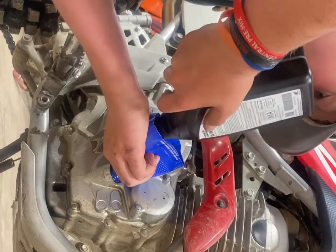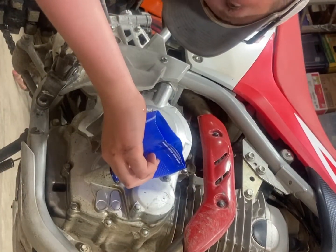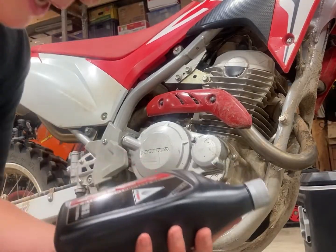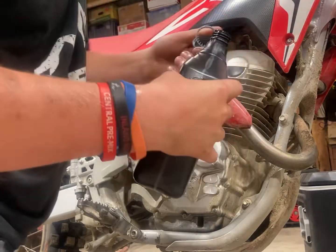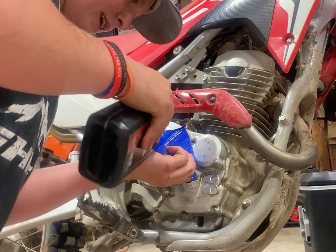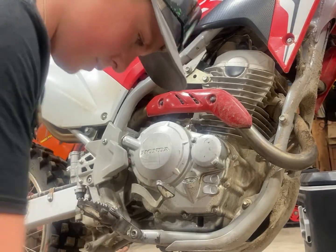Any oil companies that want to sponsor Shreddaily - I change my oil every five hours so it'd be much appreciated. Anyway, I didn't even really tell you guys this: I'm using Honda GN4 10W-30 - it's the best oil you can put in a Honda dirt bike, and it's literally made for Hondas. In a little bit I'm going to stand my bike up straight, start it up and let it get into the oil filter. Now I'm going to let that drain in there, put my plug on, wipe this off.